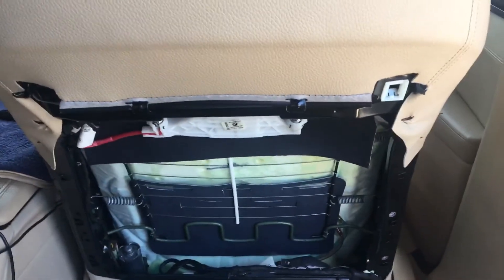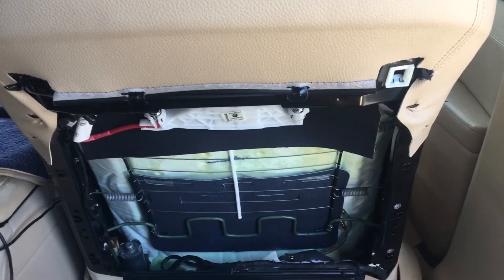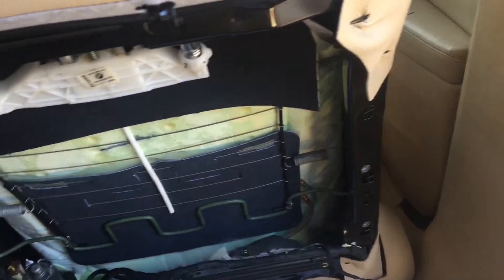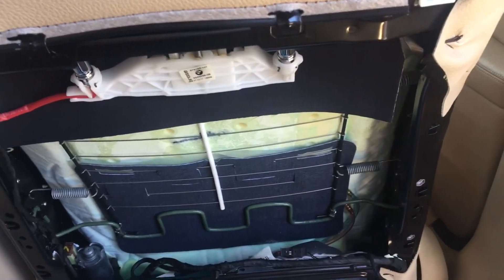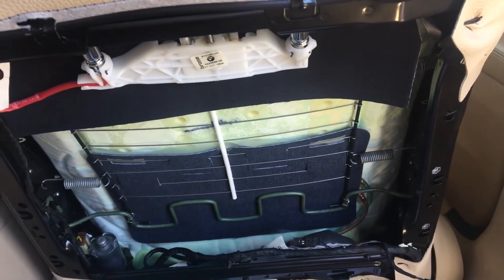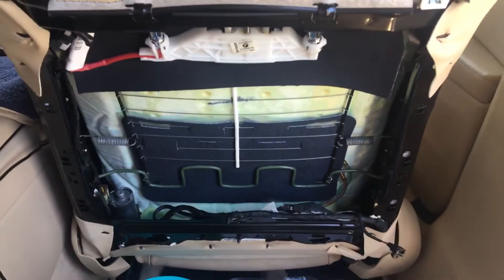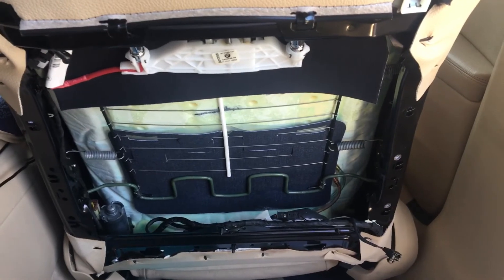Make sure to disconnect the battery — actually I didn't disconnect the battery when I took it off, but I'm not going to plug it in. I'm just going to replace the bag and leave it for a while to reset the airbag computer.